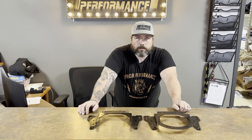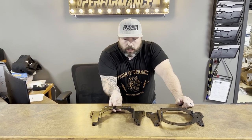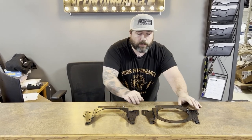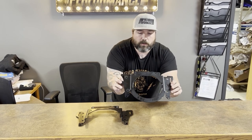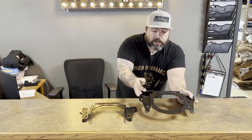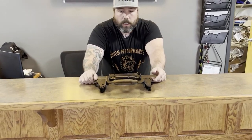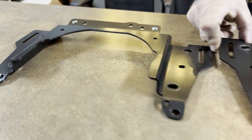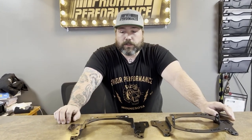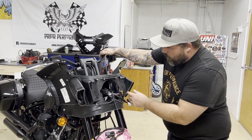Just wanted to highlight our new bracket for the Lowrider ST versus the stock bracket. The stock bracket is supported on three sides — plenty sturdy, flexes a little bit. Our bracket has deep darts, same deal, we want it to be strong since it's a lot heavier light hanging off the front. We have a ring on the bottom and mounting tabs. Dimensionally they are identical outside of that mounting bracket for the lights. Our fabricator Trevor did a bang-up job on this as usual.